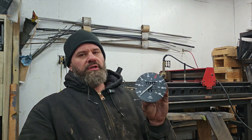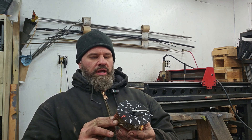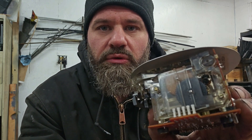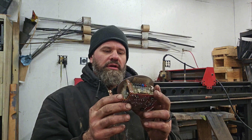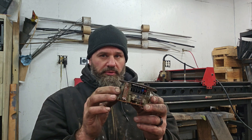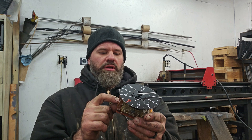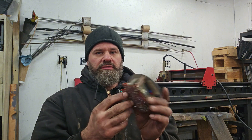So I wanted to talk about speedometers in classic BMWs. I just did my E30 and it's very common for these to have stripped-out gears. This one's got stripped-out gears, so it needs to be replaced. I replaced the gears in my E30, threw the speedometer back in, and was expecting everything to work. The speedometer actually worked — but the odometer still didn't work, which was disappointing. I had to figure out why, and upon much searching, basically everybody said there's a lot of things that can go wrong.